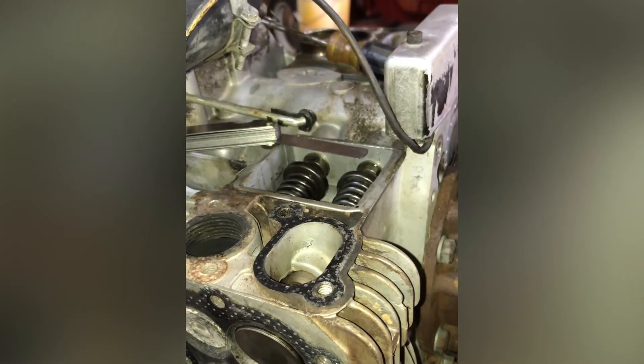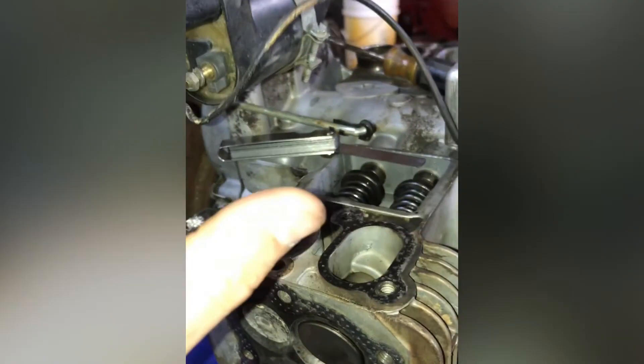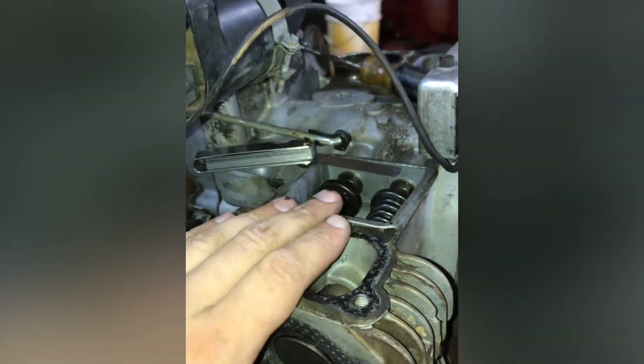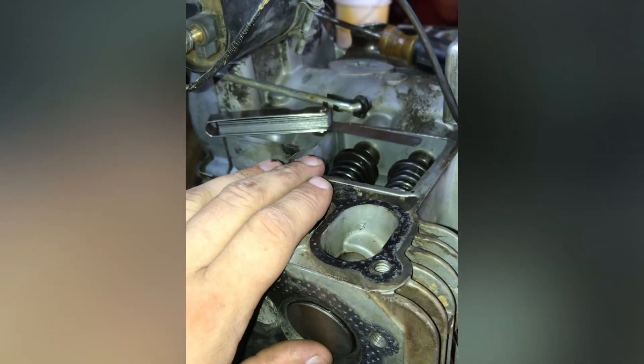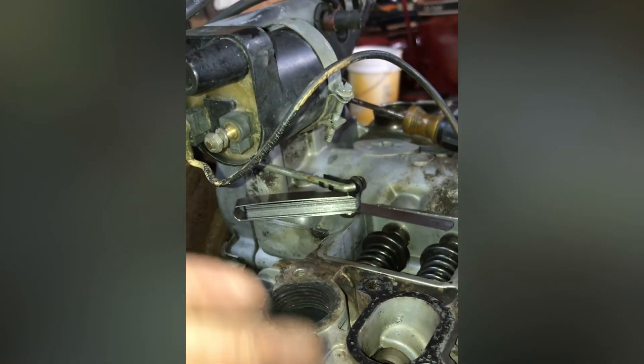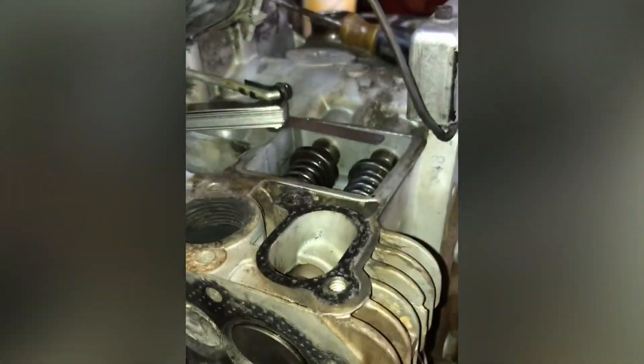It's simple, it's easy, nothing to it. And I must stress this: you have to clean your engine before you do this. I pressure washed it all off and there's still a little bit of grease underneath the intake, but you have to have a clean engine when you do this because you don't want a bunch of dirt and crap falling down inside your engine.